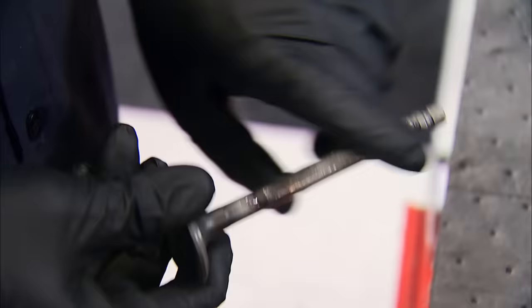The block is ready for some color. We'll use the original valve and lifter cover to keep paint out of the engine. To make sure the paint sticks, we'll spray the entire block with Duplicolor prep spray to remove all oil and grease from the assembly process. Then a base layer of engine primer, a couple of coats. With that dry, their ceramic engine paint can coat the block — it's gloss black and dyno-proven to 500 degrees.